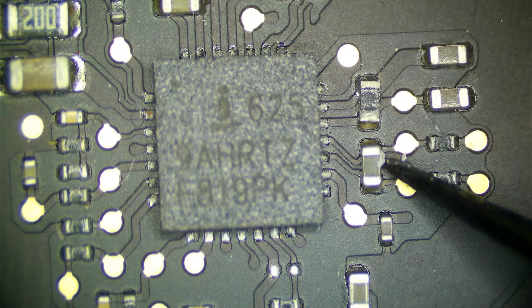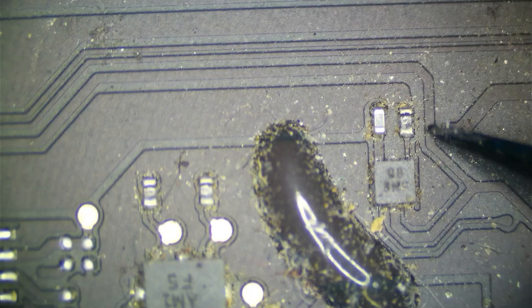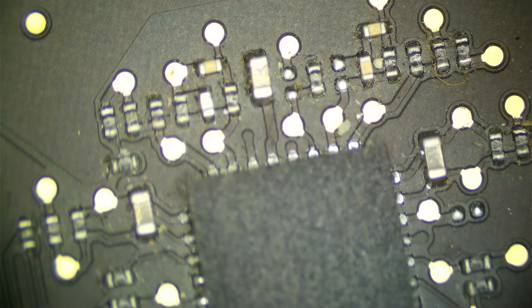The CPU v-core area can cause this too. The main area that gets corroded on these is this edge of the board here, because it's right near the vent — this is where it's going to be pulling air in. It's going to get dust here, and if you get enough dust it will condense moisture. Dust has the ability to trap moisture under it, and that's when you get issues. I'm going to tilt the board to see if we can see anything corroded, because oftentimes we could miss stuff on the pins of a chip or something like that.